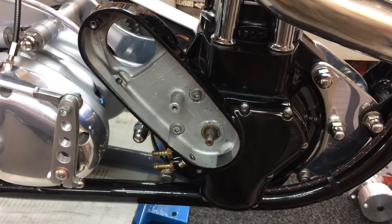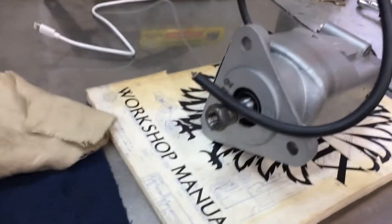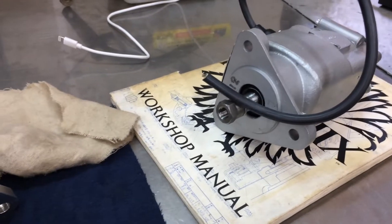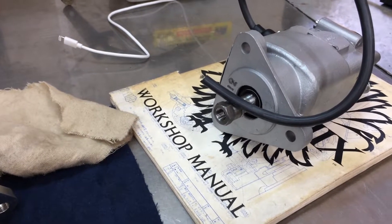Got that stripped off. Pull that off there. Mount that little pulley on that. Throw that on over there, but it'd be nice to have some timing marks - I can't find any. It's got to be in a certain position otherwise I won't get timing.